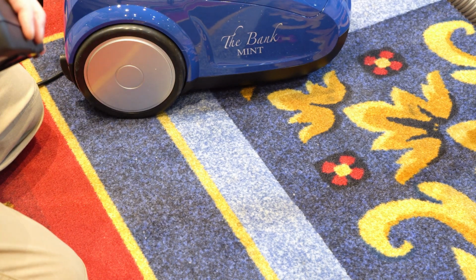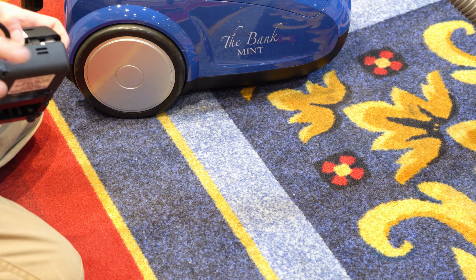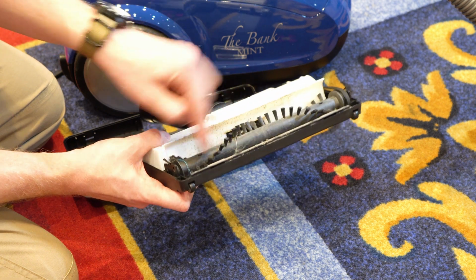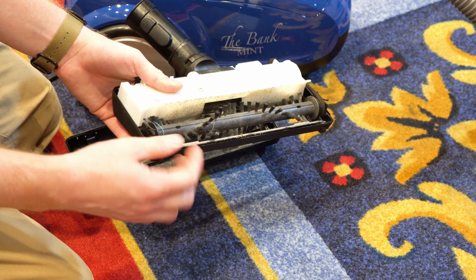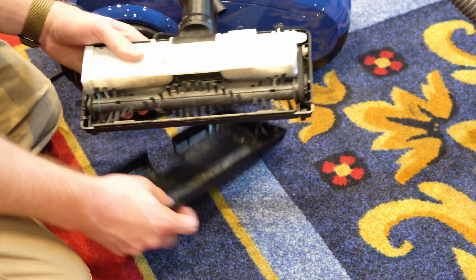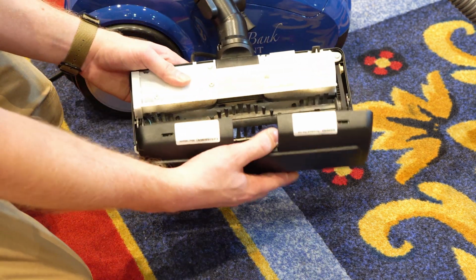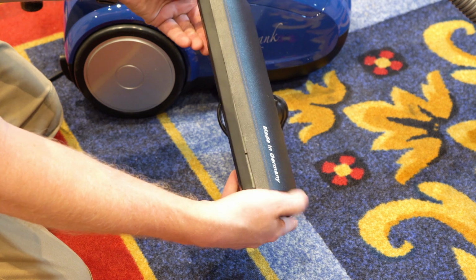It can be opened up almost with no tools. I don't have a screwdriver handy, so I had to use a pocket knife. But what's cool about this is it just opens up and you can get to anything you need to do to get in there for maintenance. There's a line, you can cut anything off. I would suggest every 3 to 6 months, just open this up, have a look, maybe clean out the end caps. This is an improved version of the older Miele 217 nozzle, if you're not familiar with the 280 ice cream sandwich style of power head. And this cover, when you're done, just snaps back on like so, and you're good to go.